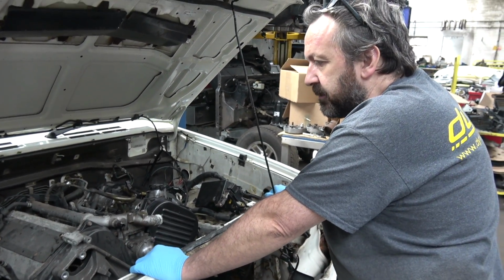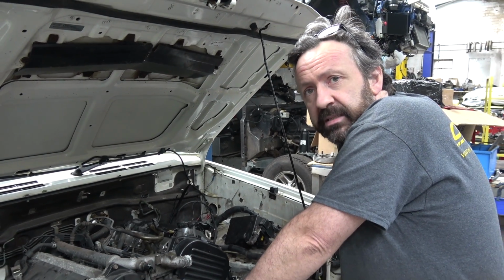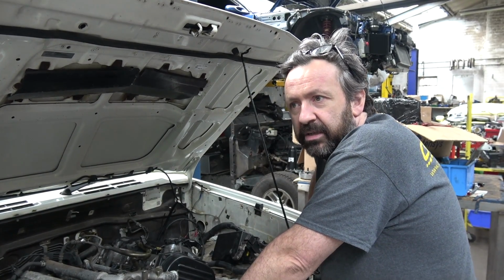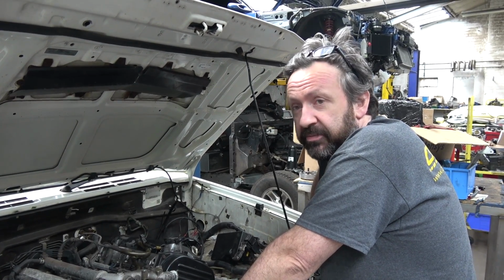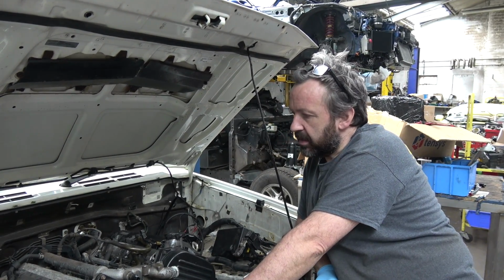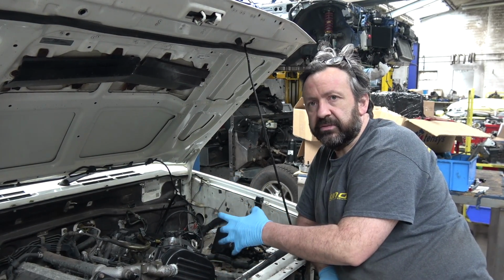You're going to take it apart to nothing, is what you're saying? Yeah. Well, the engine, I've ordered the engine. So the engine has changed a bit from last video. I was going to go with an L86, which is a truck engine with an 8-speed. I've actually gone for the 10-speed because more is better, obviously. That's out of an Escalade, so that's hopefully on its way. So it'll be a 6.2 litre direct injection, 10-speed auto with transfer box.